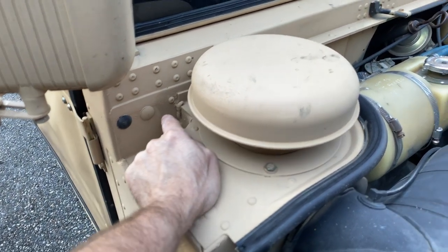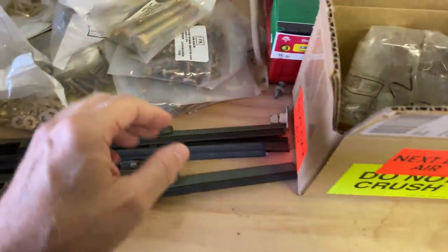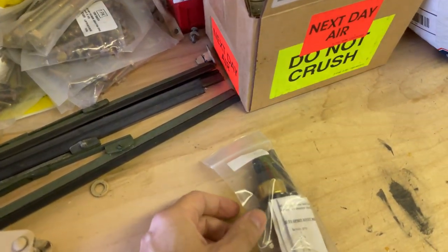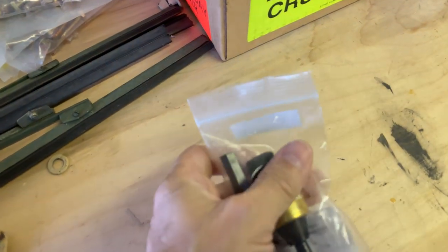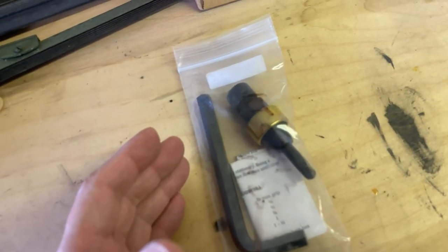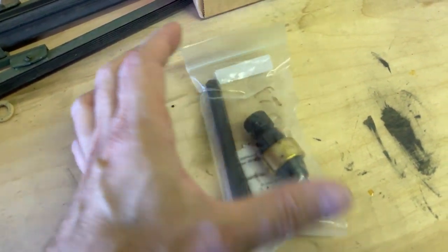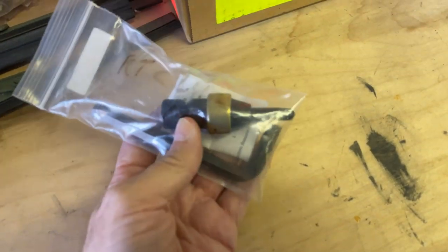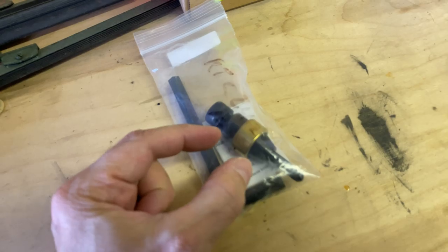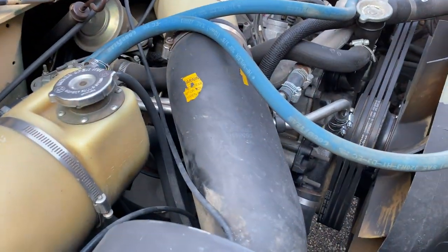What I did afterwards was, they have these, I'll show you if I could find them. Okay, you got a system like this. They have these squash nuts. So you drill a hole into your aluminum, you place the nut, you put this tool in there, you crank. They have pneumatic ones too, but this is a small version where you can get into tight places, and then it squishes a nut into the aluminum. You'll never have to worry about trying to align nuts and getting them to stay in place while you put the bolts in.